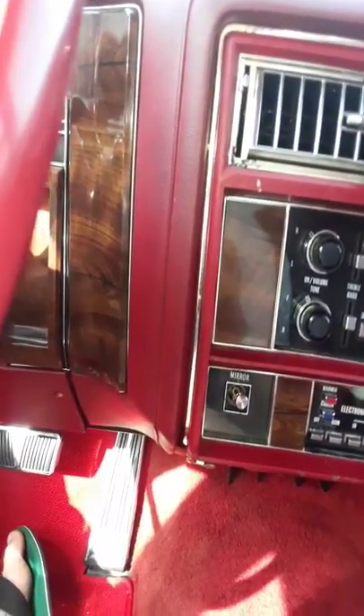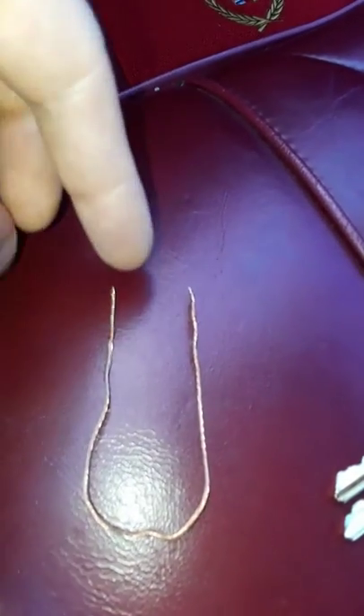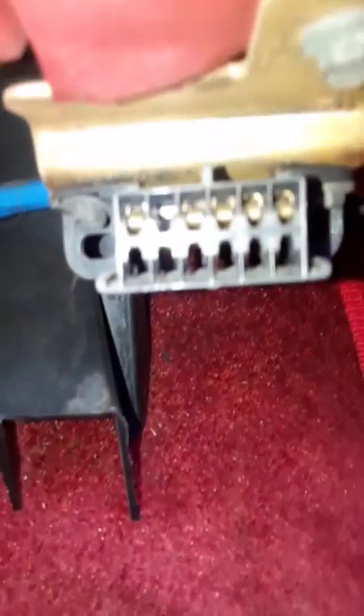All you need is a little piece of wire — flatten the ends a little bit. Under the ashtray you have the terminals; that's where you normally plug the scanning tool in. On the top right side you have terminals A, B, C, D, E, F, G.